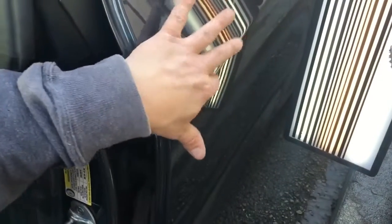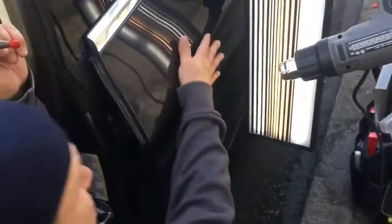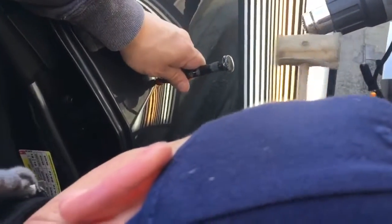I'm working the top edge of this teardrop, and then it just wants to pinch it in. So I basically have to keep on coming in, and I really want to break this down. That little high pinch right there. Gotta basically make it into a little bit larger of a dent before I can take it out, so I can make it come out flush and even. And I know my head's probably getting in the way a lot because I'm moving back and forth a lot.